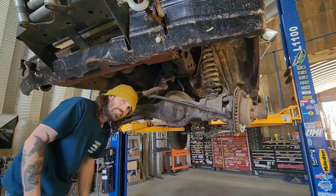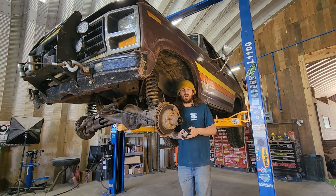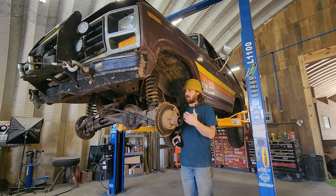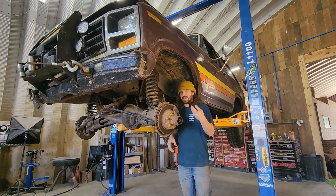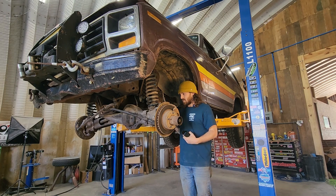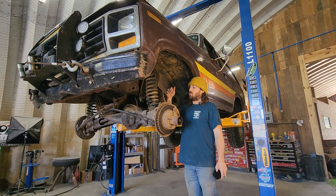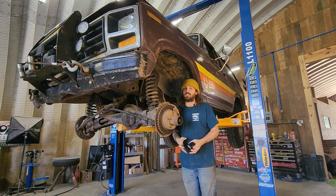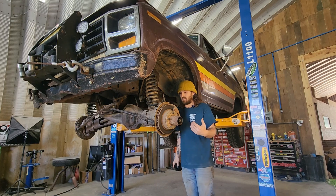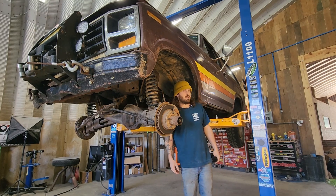I know there was probably a lot of information to take in all at once, but essentially I'm not doing the coilovers just yet because I'm a little nervous about cutting my front axle apart. What I want to do is eliminate that equation and set the front end up solid. This is a one-and-a-half inch lift spacer plus a one-and-a-half inch coil, so it's going to be three inches. That way when I set it all up I can get this thing dialed in perfectly — and when I go to the coilovers, I know my measurements of distance, height, all that, and all I have to do is crank the coilover, weld the brackets, and know it's going to be set right. This is my precaution. Most people would probably just blow this apart, but this is my first time cutting my TTB up, so wish me luck.